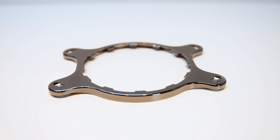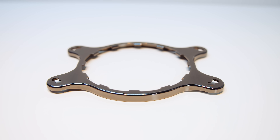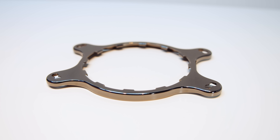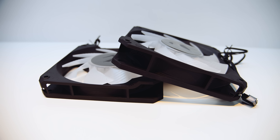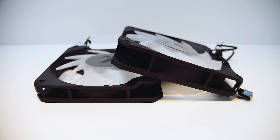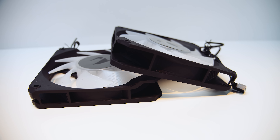To mount it to your motherboard you only need these parts here. You're going to need this bracket — this bracket is for AM4 installation only. We do have an Intel guide coming at a later date, but this is for AM4 only. The only other thing you'll need are these two addressable RGB fans that also come with the liquid cooler. These cannot be bought separately and they have their own RGB connector that's not compatible with anything else.